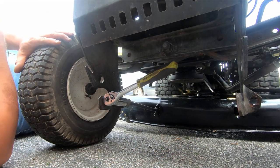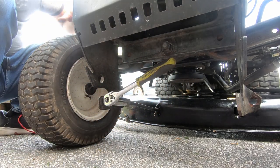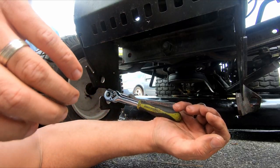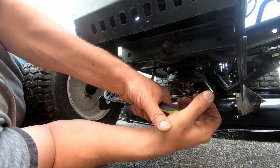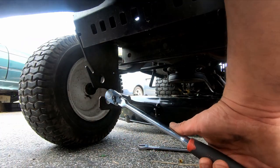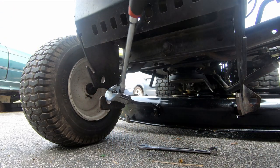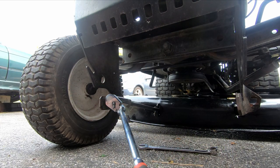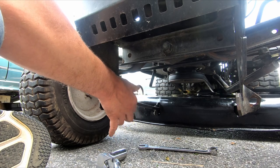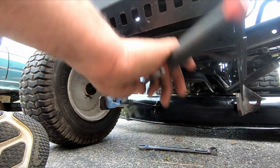Oh boy. No, actually, you know what? This one has a locking nut, like a jam nut on the backside that I'm going to have to loosen. And hopefully it's the same size. Let's see if a 3/4 wrench fits over that. Yep. I don't think that's been moved in about 23 years, how old this thing is. Yeah, we need some more persuasion. Oh. Yeah, they say bust your knuckles for a reason. Now it's loose, you just turn that nut on the inside. I'm going to back it down quite a bit, all the way. And then we're going to tighten this one up until I get it to something that looks close-ish.